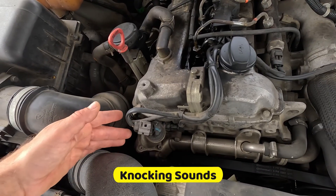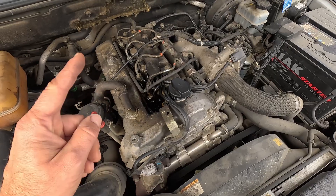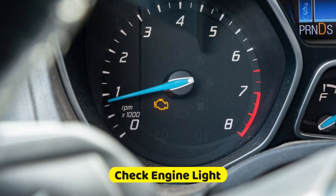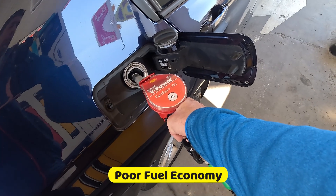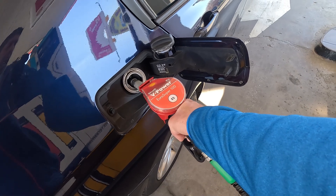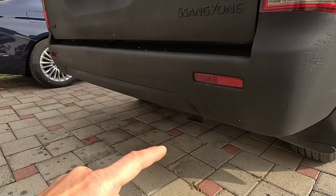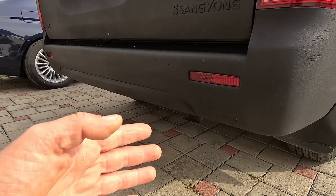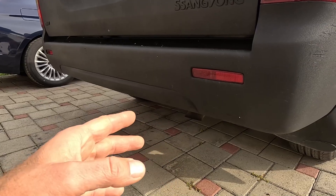On the other hand, a stuck closed EGR valve could cause knocking or pinging sounds under acceleration. The reason is that combustion temperature goes up when exhaust gases aren't flowing into the intake. Next, the check engine light will almost certainly come up if the EGR valve is acting up, triggering various EGR-related codes. Another thing that will take a hit is fuel economy — an engine that doesn't run optimally will burn more gas. Additionally, since the EGR's primary role is to reduce emissions, you might get more harmful exhaust gases through the exhaust; this might only become apparent when your car fails an emissions test, though you could also see a lot of black smoke from the tailpipe under load.